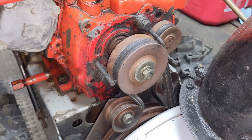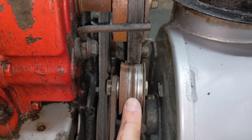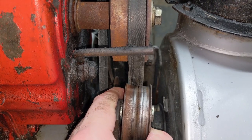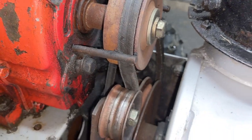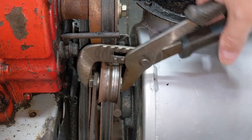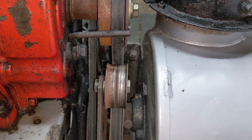So you may end up running into a belt that throws snow a little bit better but won't last as long. In that case, go ahead and replace it, and I would highly suggest running a Kevlar belt if you can on your application. One more tip: in order to keep your belts lasting longer, look at the alignment of your idler pulley compared to the position of your belt, and make sure the belt is centered up in that pulley. Sometimes these idler arms can bend and your pulley can get into a position where it's kind of off center, which could end up chafing the sides of your belt. Get yourself a pair of channel lock pliers, and if you do have an idler arm that is slightly bent, you can grab the idler arm and bend it to make any minor adjustments to get that idler pulley lined up perfectly. Doing that will prevent any belt chafing and will extend the life of your belt.